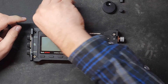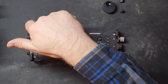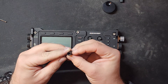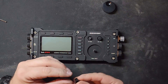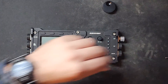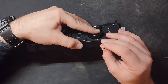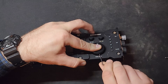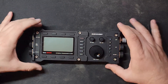Nice and snug but not overly tight. Start by hand and if you feel any binding, do not go further — we can risk stripping out the very nicely machined threads. These top screws have a little cup indent and match perfectly with the orientation. Now we need the 1.5mm Allen key. Hold it flush, put in the key, righty tighty but not too tight — just so it doesn't come out, no major wobble. Check for movement and it works great.